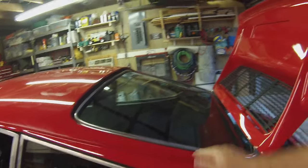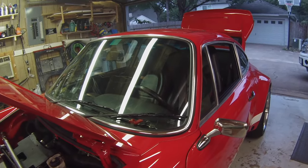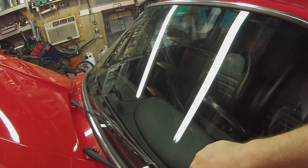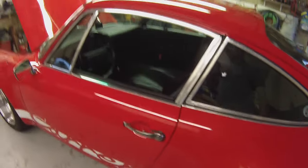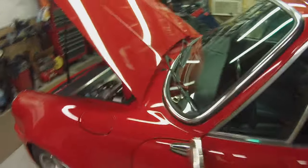They either come black or chrome, and that's all there is — I had no choice but to buy the chrome ones. You can see I leave the key here — it's both keys: the key that runs the car and the cutoff switch. The way I have the cutoff switch wired, it's very easy to change around, but I have it wired for storage, which means whenever I turn that off there's no power anywhere. You can turn it off and let the car sit for hours, days, weeks — it will run nothing down because there's no draw on the battery at all.